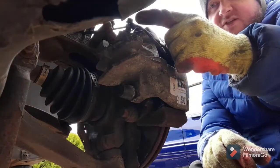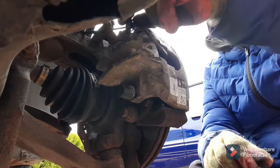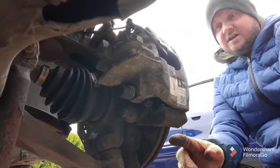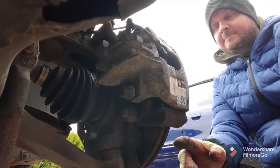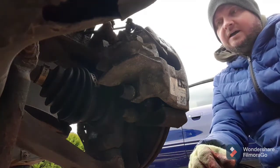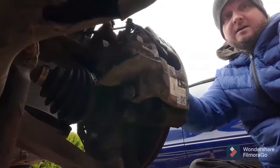I've also put a little tiny bit of electrical tape on that chafed wire - it was just getting caught on that rubber bracket. So we'll do the other side now, put the pads on, pump the brakes, check that it stops okay, and hopefully that should solve our strange braking mystery.